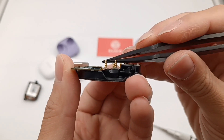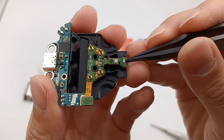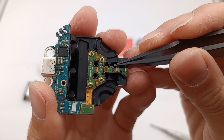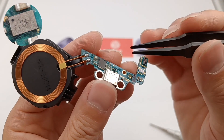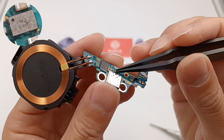These are the pogo pin connectors. Here is the indicator of the charging case, and the indicator of the earphones is next to it. This is the coil element, marked with KZ1UC. On the other PCB, there is an input protection chip next to the USB-C port.